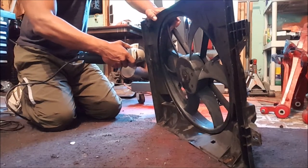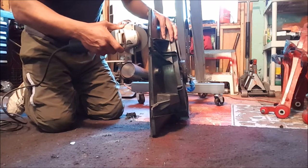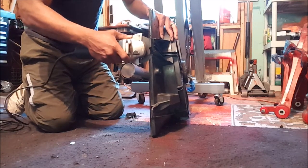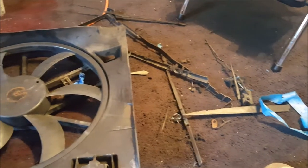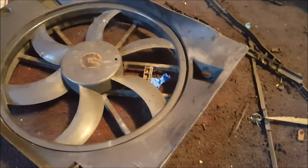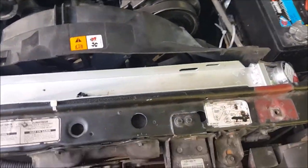I'm going to start by chopping off these mounting tabs first, because the fan shroud is wider than the actual radiator area. I'll figure out how to mount this thing later — I can easily make mounts for it. Then the next thing is to reduce the profile, so I'm going to chop into this lip here and try to reduce that. I basically went nuts with it — I started with some lines I made in tape, made those trimmings, and then just started cutting off everything I possibly could to make this thing have a good fit.